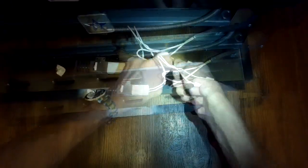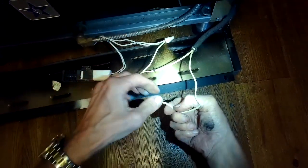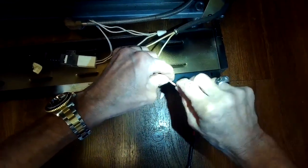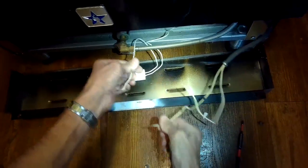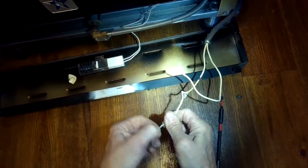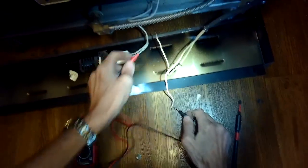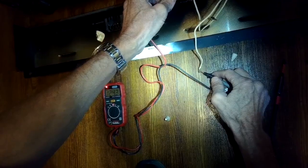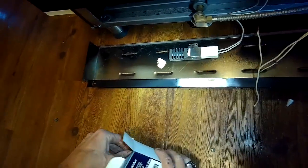The new igniter is a pretty cheap one — probably fifteen dollars on Amazon. It's an Electrolux flat oven igniter and they're very common, working for many different models of ovens. You can get the exact one for the Blue Star, but there's really not much difference in how they work or how long they last, and there's a big price difference. I'm also going to test the voltage — I have it plugged in, the oven set for heat, and I saw 120 volts coming down to the igniter, so I know everything's working except the igniter, ruling out a thermostat problem.